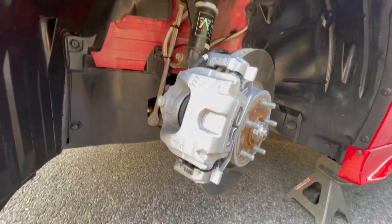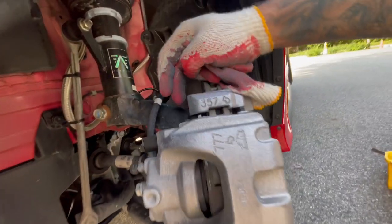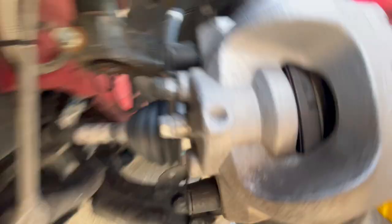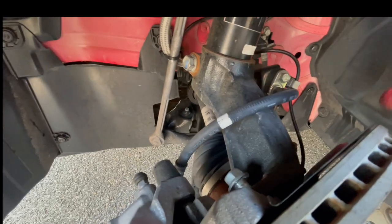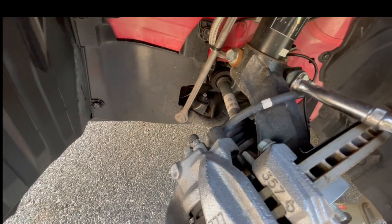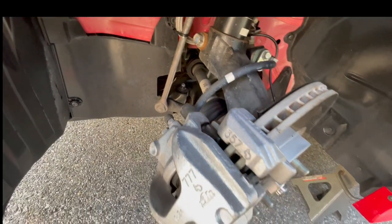Since I'm taking out the entire assembly, I'm not going to take it apart — I'll leave the brake pads, bracket, and caliper all together and just take off the two 17mm bolts behind the rotor. There's one here and one there. Once those are loose, also take off this 12mm bolt that holds the line so you have more slack to move around with the caliper, since once it's off you only have so much length. Take the 12mm bolt off first, then do the 17s.